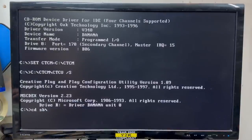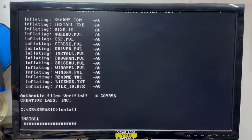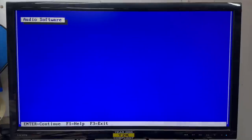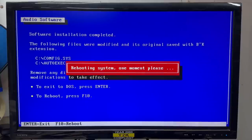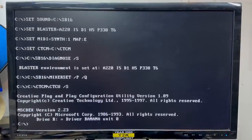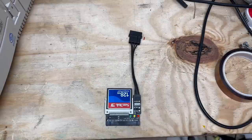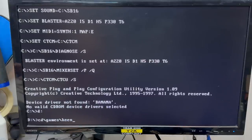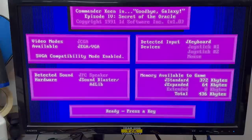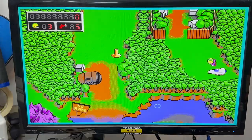Now let's do the actual driver install. This looks promising — very good. And one more reboot. Looks like we have an audio driver now. Let's get some games copied over to this thing. That CD drive can't read a CD-R — too old for that, I guess. Not to worry — the good old CF-to-IDE adapter will get us around that. It's detected and DOS recognizes it. Let's just do a quick test. We got Sound Blaster sound.